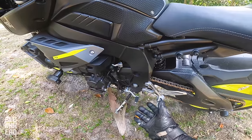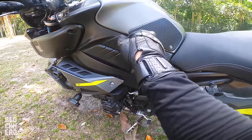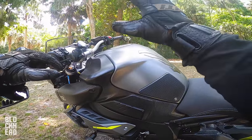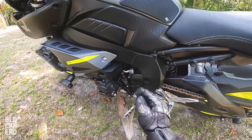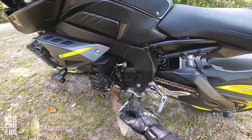It does work usually at higher speed whenever you're getting on it, riding a bit more spiritedly, which you guys will see. You also don't have to let off the throttle — you can pretty much keep throttle pulled back. It cuts the power to the engine for you, leaving that little bit of time for the transmission to shift. That's a quick shifter.